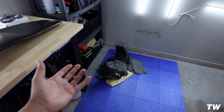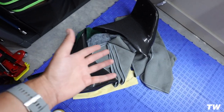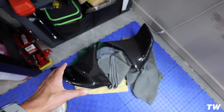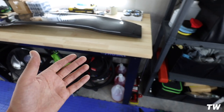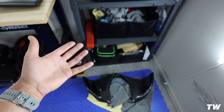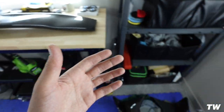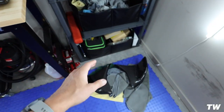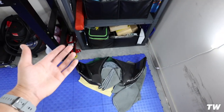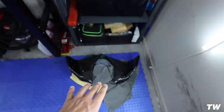The thing I don't love about having all carbon is that it's really hard to work with. If this was plastic or FRP it would be a lot easier to adjust things and make this form fit a little bit better. With carbon, you don't get much flex out of it — it either fits or it cracks. So in my opinion, if you're going to do this wing and you know you're going to paint the sides to match the car, just go ahead and get the one with FRP plastic sides — you'll have a lot more flexibility when it comes to fitment.